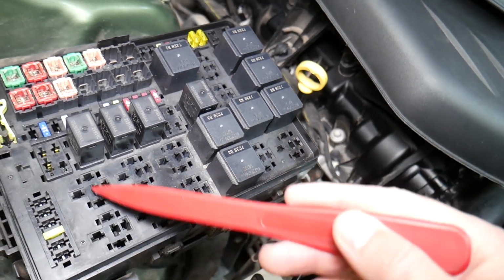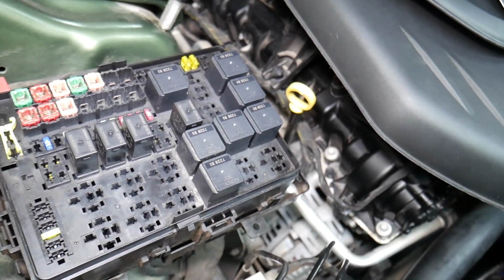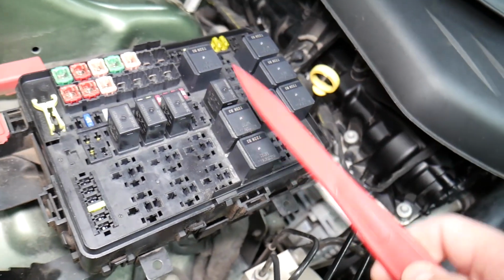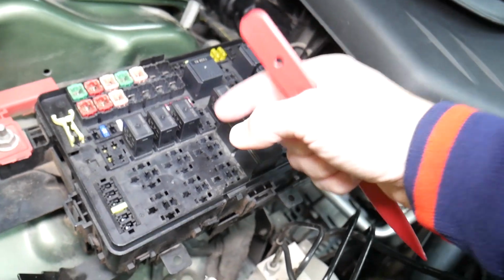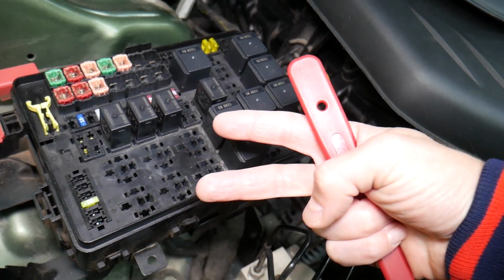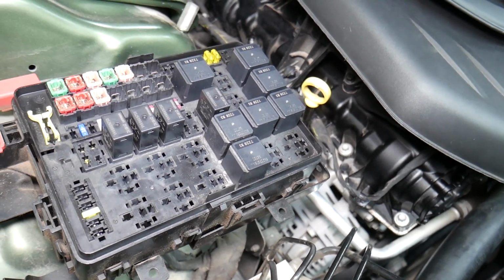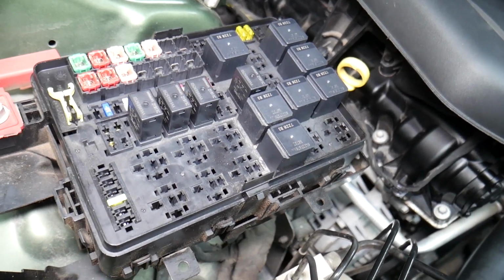And for certain fuses, it's important to disconnect the car battery when removing them, otherwise you can burn the electronics. For instance, when working on airbag fuses or anything like that, you need to wait at least 1 hour after disconnecting the car battery, and if you're not qualified and certified to work on the airbag system, I would never recommend doing that. When disconnecting the car battery, a common mistake people make is not knowing which battery terminal to reconnect first. If you do it the wrong way, you can burn electronics modules. How do we know about that? We burned a traction control module on a BMW that cost us $2,000. We'll put a link in the description of the video below showing which battery terminal to disconnect first. Check it out for your convenience.